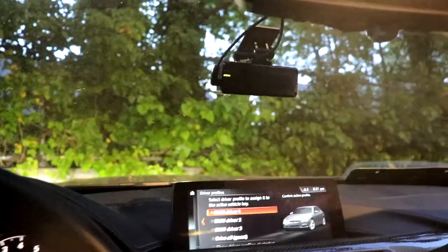All right, guys, as you can see, the dash cam is fully connected, as well as the one in the back there. I ran the cable up from the OBD2 port, and I tucked it into the weather stripping here. And it looks pretty good. Ran it across here. It provided a little bit more wire than I probably needed, but luckily there's so much give between here, the headliner and the windshield, that you can just tuck all the extra wire right in there. So it's not really a super big deal, but it's all taken care of.